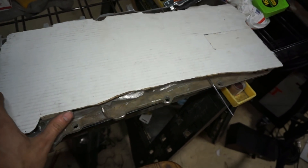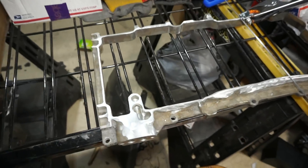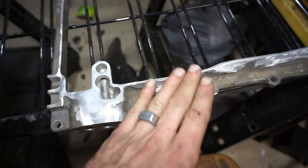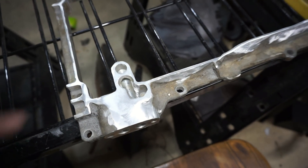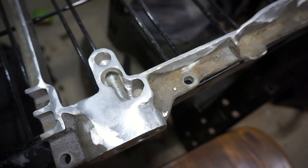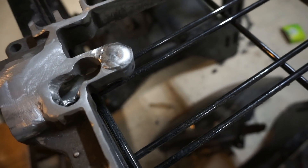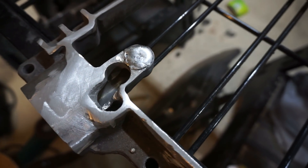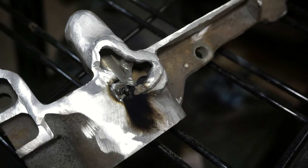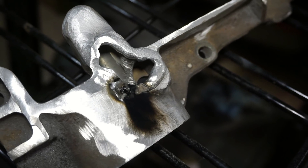I got this template pretty much cut to go over the bottom here. Rather than putting a plate on top and having to weld all the way around on the inside where it's hard to reach, I'm going to try to fill and cover it from the top side. That first one actually kind of worked — I did it just to practice. I'll knock it down a bit and try the other ones. You can actually see oil bubbling out — it'll be going fine and then suddenly hit a spot and just explode, all dirty.